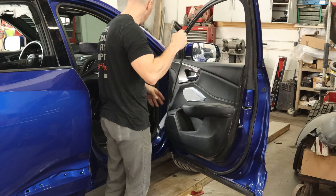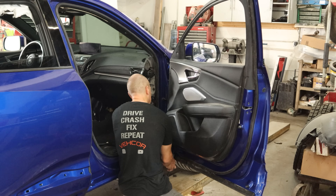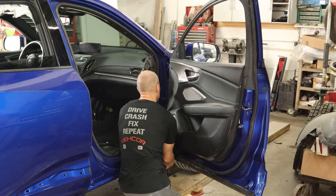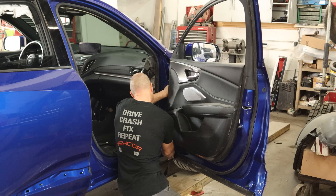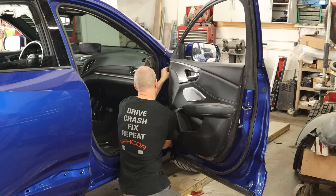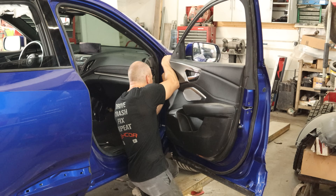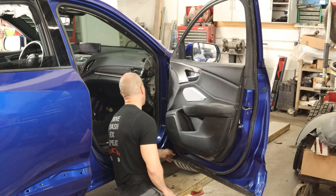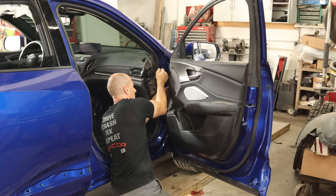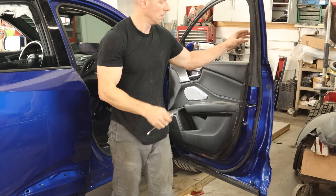I've been dreading this part for a while — this is our little gasket that goes up in front of the door and closes up that gap. In order to get it in here we need to loosen up our hinges. The top we loosen up almost until it's all the way out, then work your way down. The bottom one I just loosen up a little bit. I loosen them up on the door side so that the self-aligning bolts will line themselves back up. Now we're just going to slide that thing up between the hinges and the door, slowly, then push our little push pins in somewhere right behind the hinge. Once we've got them all in there, our gasket's stuck to the door. I'm going to go ahead and tighten up our door hinges — start with the top, snug it up, work our way down, and make sure it still closes nicely.